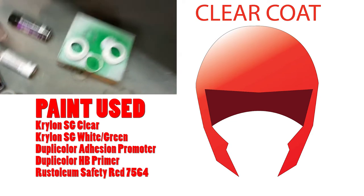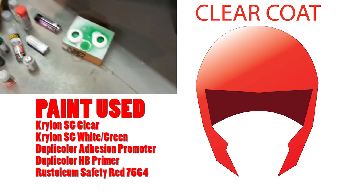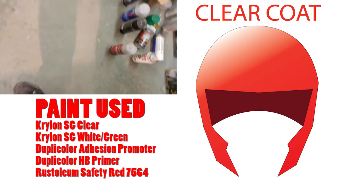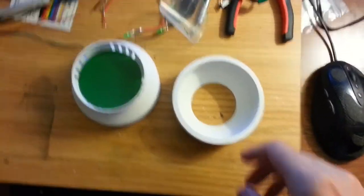For a smooth perfect paint job, wait 24 hours, then wet sand your actual color coat with really fine sandpaper like 2500 or 3000 grit, do your clear coat over top after that's fully dried, and then you might want to do a final polish on top of that clear coat.